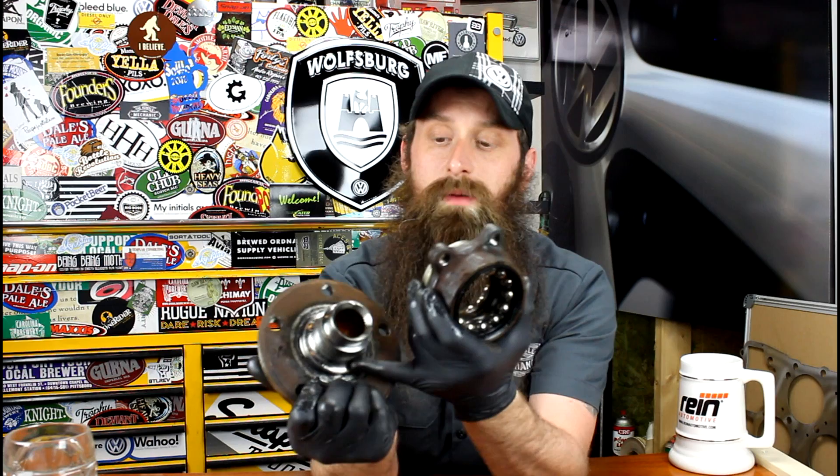There's an inner and an outer pack of ball bearings, so you could have a flat spot or a broken ball inside either one of these bearing packs. Also the race that connects and holds all these ball bearings in place could break. You could have damage to the race where the ball bearings ride, a bad spot inside the speed sensor ring, or moisture getting inside causing rust. Impact damage can also destroy these wheel bearings. I had a Beetle with about 2,000 miles where this magnetic ring had a weak spot in it and was tripping wheel speed sensor faults.